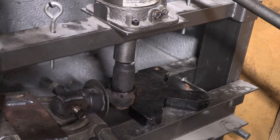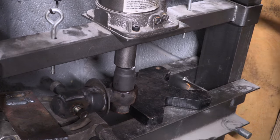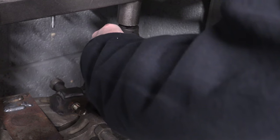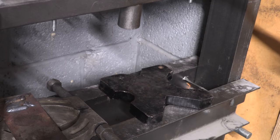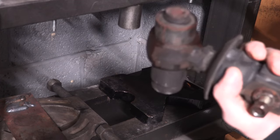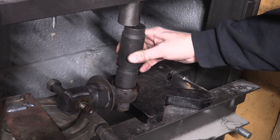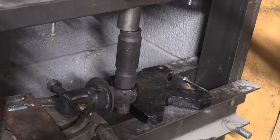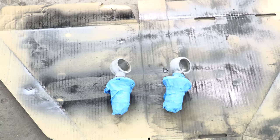Meanwhile, back at the shop, I want to close out that last third of the rear subframe bushing set — the toe link connector bushings. They're a little awkward but you can caveman these things right out, sleeves and all. One of the bushings was cracked, so it would have needed replacement anyways. Doing this doesn't delete the movement of the steering assembly at all — this is actually a flexible molded rubber joint with steel bits inside of it; it still flexes even though I'm installing a rigid bushing on the end of it. Next, they were sandblasted and coated with two coats of chassis and roll bar paint.